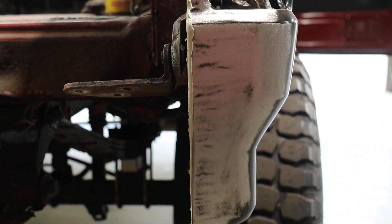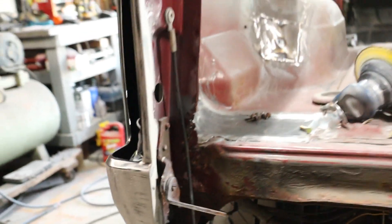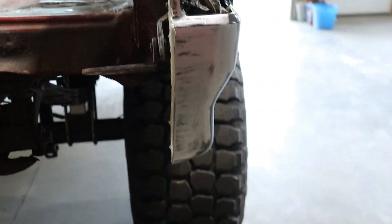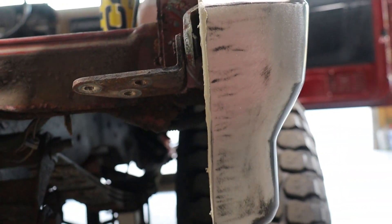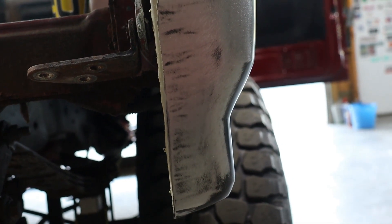Another thing with these quarter panels - you can see this kind of zebra stripe looking thing going on. Whenever these things get made during the process, the backs typically get this ripple finish to it. So I'm going to take some body filler and smear it, get a nice skim coat on there before primer. It might black out in primer, but just to be safe we're going to put a nice skim coat on there and get it nice and smooth.